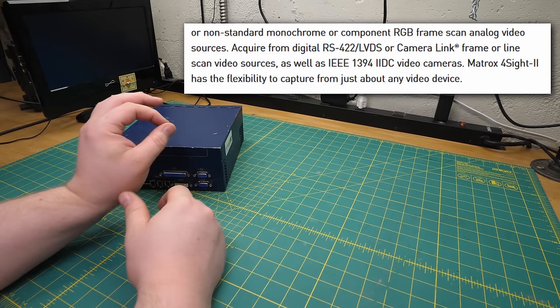It shipped with either a Pentium III or a Celeron — both single-core designs — and didn't include a lot of RAM or any other special hardware. It's really not a very powerful machine. Although the pamphlet does state that it has a Matrox G450 graphics chip, and that is intriguing. It makes sense given who made it, but it's still weird to think about. If you're younger than me, you might not remember that Matrox were a real up-and-comer in the GPU space for a bit — they were actually trying to compete with AMD and NVIDIA for a while.